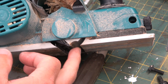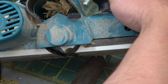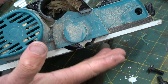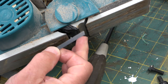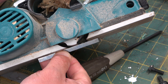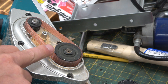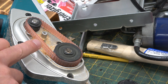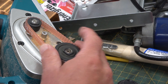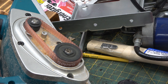The way this works for the depth of cut adjustment — here's the blade here — so that's going thinner and that's going thicker. You see the difference in the plane here. Under this little cover here we've got the pulleys. Serpentine — not a serpentine belt, but a V-groove pulley with what looks like polyester threads through it. And urethane, not rubber, but urethane. These pulleys, of course, are sintered metal, and then cooked so that all the grains cook together.